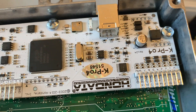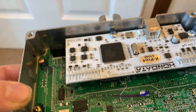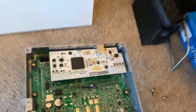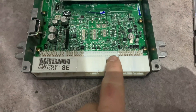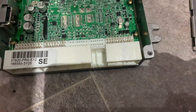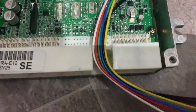K-Pro 4 — very nice, some circuits and a little board in it really, with a big blue stripe on it. So this wire here connects up to one of these connectors. I need to work out which one it connects to first — there are instructions online. It's the analog inputs that we need, so it's this side here. What I've ended up doing is taking a little notch out of the plastic, because nothing plugs into that spot. I could drill it, but I just took a tiny bit off the top, which means the harness will just sit in there nicely. So that's plugged in.